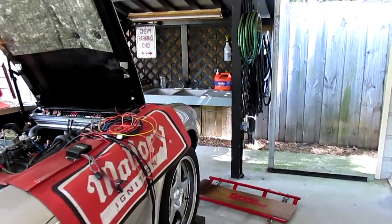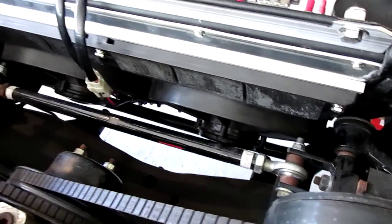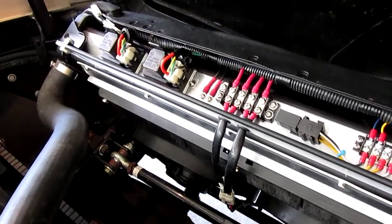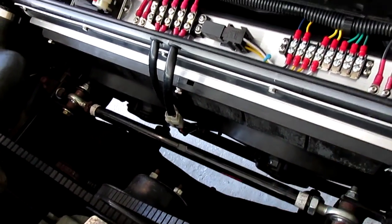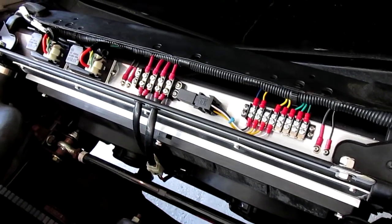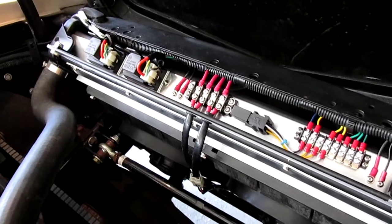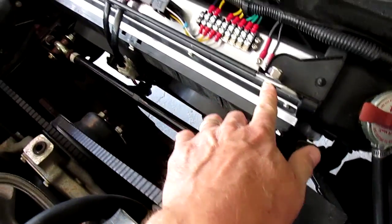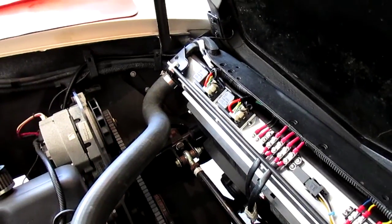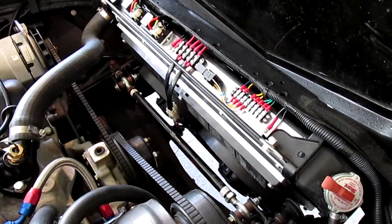Now we're going to take a look under the hood and see the fan shroud and talk about the wiring. You can see the fan shroud worked out very nice - you can see how the fans bolt to it. Up above it I put what I believe is one and a half inch angle aluminum and also put a rubber edge on it. This is where I brought the harness up and connected the fans and the controllers. I've got it set up so that you can remove that aluminum angle with just the two bolts at the ends - all stainless steel fasteners - and you can swing that out of the way, unbolt the fans, and pull the radiator right out if you ever need to service it.